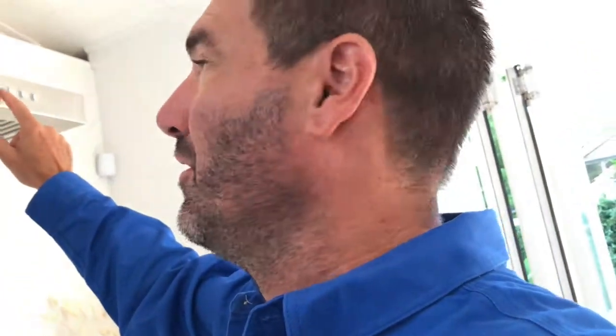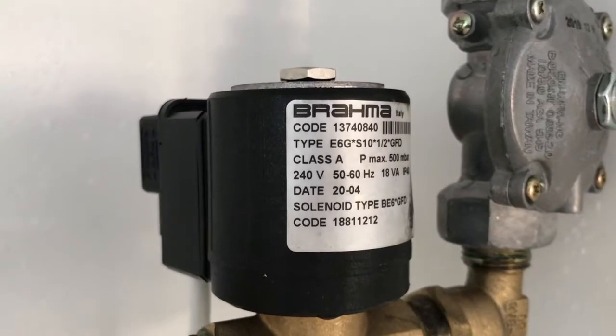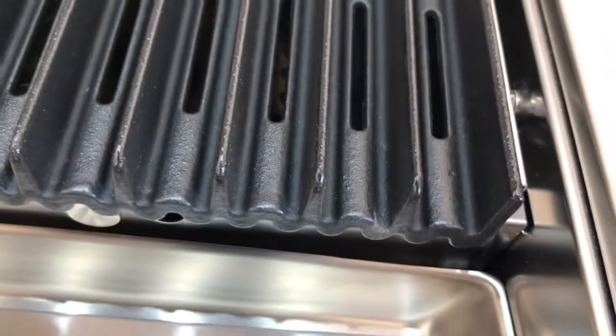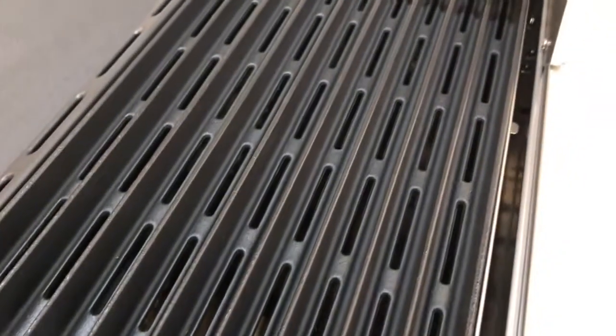But as soon as I've turned the fan on — I don't know if you can hear it, but you'll hear the solenoid down there click on. Hear that little click? That means it's on. Fan's on, solenoid's opened up, and now you'll see — I'll put it on — gas is fired up. See, all the burners are on there now.